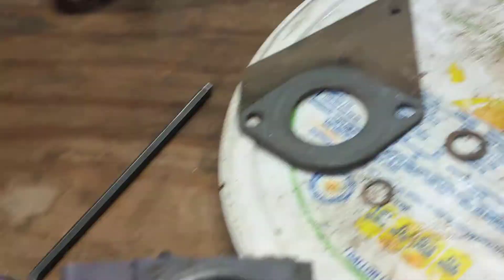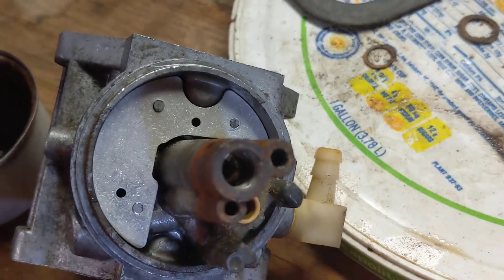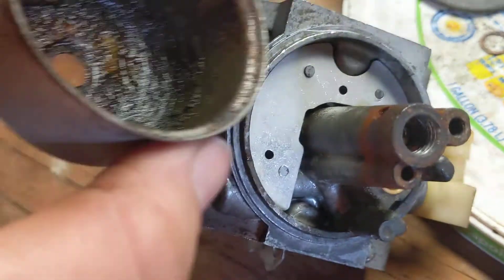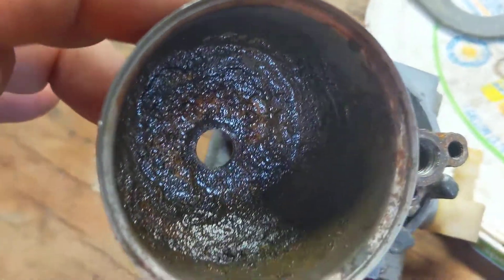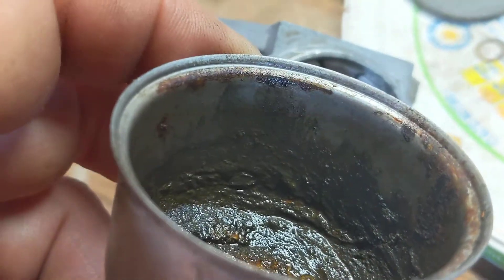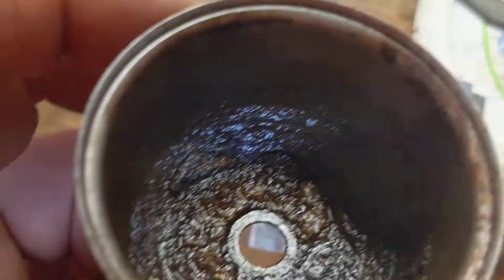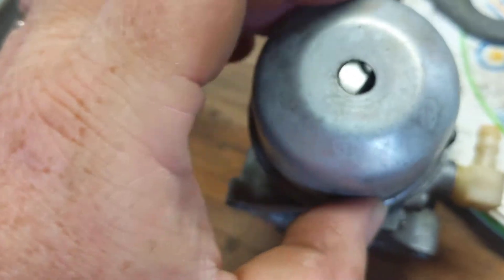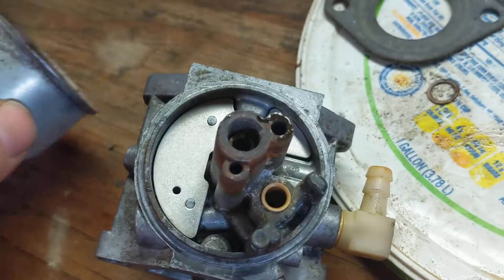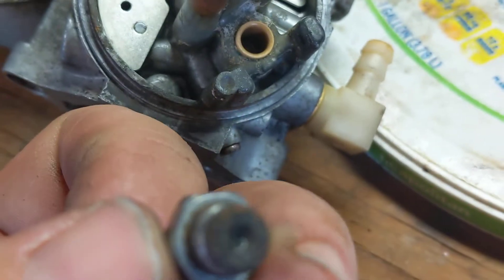This is the carburetor off that mower. I'm nowhere near a carburetor expert, but I've seen a lot of carburetors. Before I bought the new one, this thing is rusted down in there — you can scrape it out. It's been soaking for two days and there's rust at the bottom. This bowl goes on here like that, and this main jet area has a bolt that goes through the bowl and screws into the main jet. This is the end of that bolt.